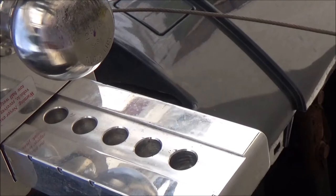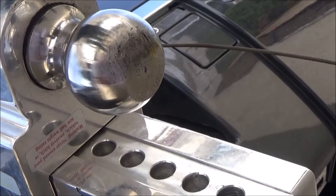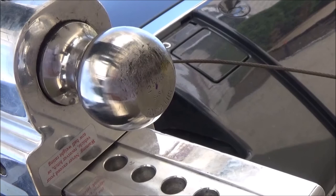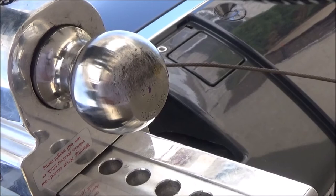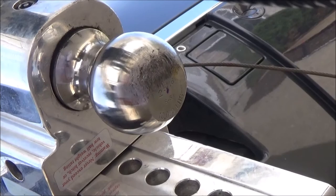So once we had that there, we measured the distance to the front of the left axle bracket that was tacked in place. Got what that was, went over to the right axle bracket, got it to the same exact measurement, and then tacked that in place, and put a few more tacks in after that. But that's where we're at now, and time to complete the welding on the rear axle. Next update will be as we are tacking the front axle into position.